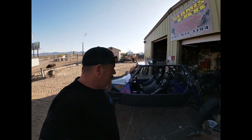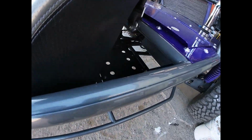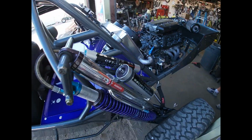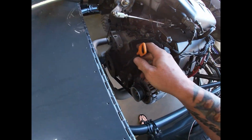So we're going to jump into the wiring on this thing and try to figure out why Vtec ain't working. We'll take a look at the ECU and we'll tone out all these wires going back to the Vtec solenoid, and we'll get it figured out. So the first thing we're going to check now is the oil level. Let's pull the dipstick out.